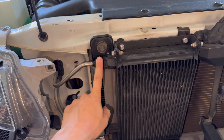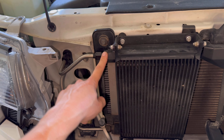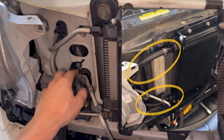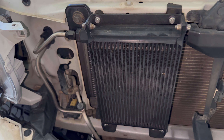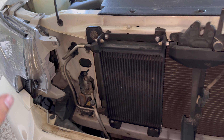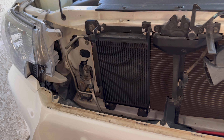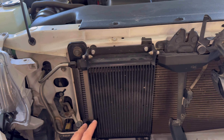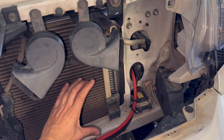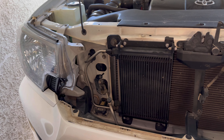This is the negative 6AN style fitting, but the cooler also comes with a straight fitting for regular rubber hose. You can definitely do regular rubber hose straight down to the trans hard lines — I would put a little protective coating around it so nothing chafes and splits. I really wanted to do this build as best I could, so I did stainless steel hard lines, XRP fittings, ARP hardware, and the Derale cooler. There are a lot of brands making coolers, but just know that 25 rows is about the biggest you want to go — the stock one is about six or seven rows, roughly the size of a cell phone.